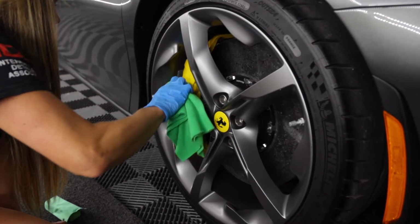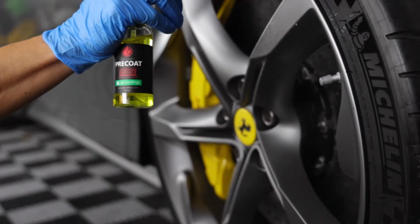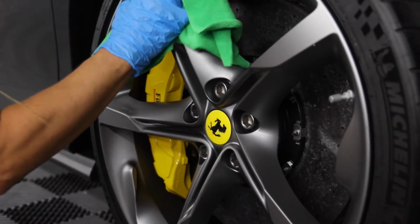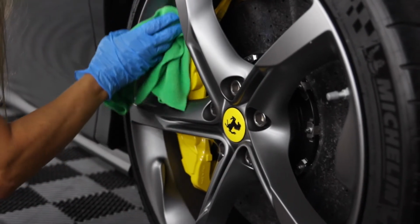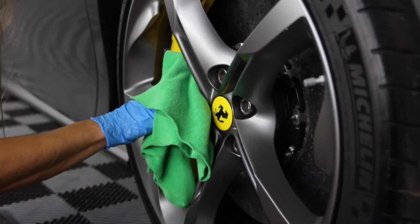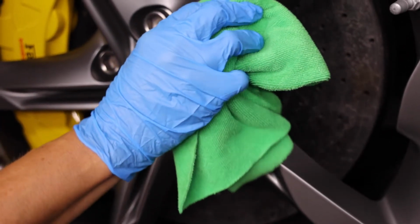Before applying EcoCoat Pre-Coat, make sure the surface is dry. EcoCoat Pre-Coat is used after cleaning the surface, so the coating will adhere straight to the surface of the wheel. In order to permit sufficient chemical bonding of EcoCoat Wheel to the substrate, the surface must be carefully cleaned of all contamination before application. The long-term stability of abrasion resistance of the coating depends on how well EcoCoat Wheel has chemically bonded with the surface. Coat the surface immediately after cleaning to prevent any contamination.